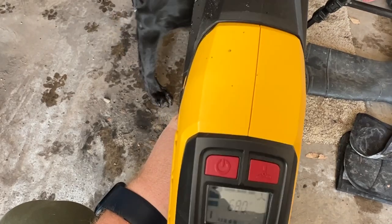I think I'm done making them fit. I basically just used a pry bar and the heat gun — get it nice and warm, then use the pry bar to just push it where I want it to be, and leave it there for 30 seconds to a minute afterwards to kind of hold it in place. And that's how you fit 255-80-R17s on a GX460 with a small lift.